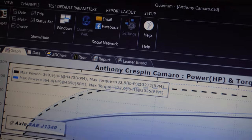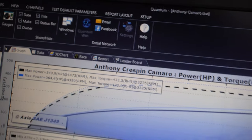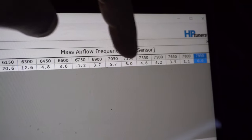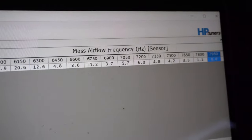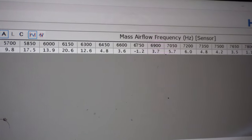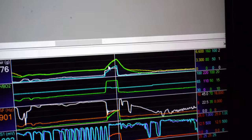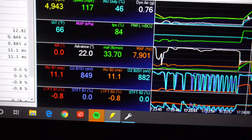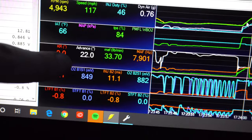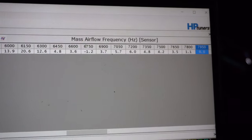As you guys can see: first pass made 349, second one made 364 horsepower and 433 then 472 torque. The fueling is off by about 4 to 6%, so I'm going to smooth this out a little bit. It looks like it's a little rich where it initially rolls in — that's the enrichment rate, which can be smoothed out as well. Looking at knock retard, I'm not seeing any, which means we can throw some more timing in it. I have 22 degrees in it right now. I want to get fueling figured out first, and it's good enough now that I can start revving it higher.